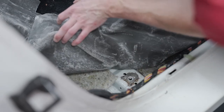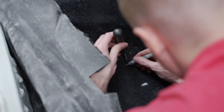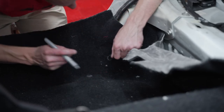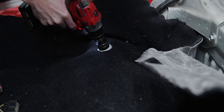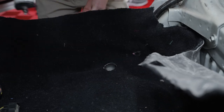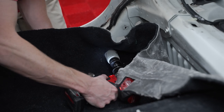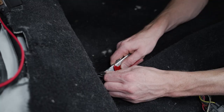Now you can mark the holes for the seat hardware. I started with the two rear holes first — whenever the hole was identified, I poked a hole in the carpet with an appropriate tool and marked the area with a silver marker. Repeat these same steps for the rearward hole for the push pin and the seat belt anchor. I then lifted the carpet up and cut the holes by running the correct size hole saw in reverse. Pay attention not to cut your hand that's underneath the carpet. The hole saw method creates a very clean, factory-appearing hole. If you don't have a hole saw, a good old-fashioned sharp razor blade will do the trick. For the inboard front seat bolt hole, identify the position and cut the carpet with a razor blade to mimic the factory opening.